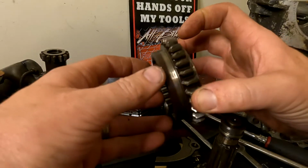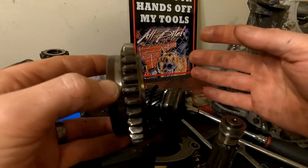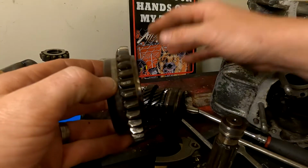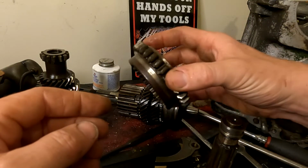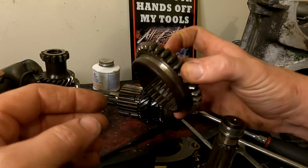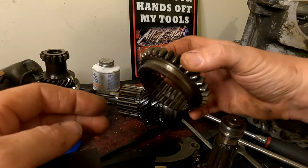As you can see here, this is a straight cut gear. This gearbox on an 850, because it was the first generation gearbox for the Mini, which then went on to increase to a 4 synchro gearbox, this car only came out with a 3 synchro gearbox, meaning first gear has no synchro whatsoever. Because the gears are straight cut in first, a lot of the time you'll find that when you go to engage the gear, it will just simply grind.